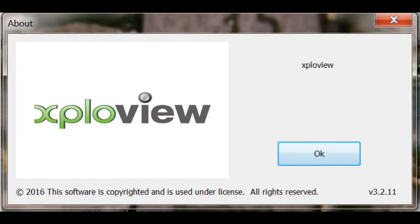If any of you know of a newer version that has come out, please post it in the comments — we'd all like to know about it. From my experimenting, the software will load and run from XP onward, but the driver is only workable from Windows 7 onward. You will lose some functionality if you don't have Windows 7 or later with the provided driver installed. Windows will default to its own driver, which gives you some functionality but not full functionality.